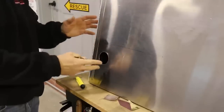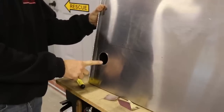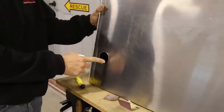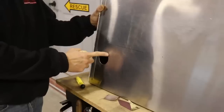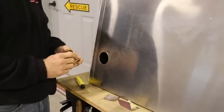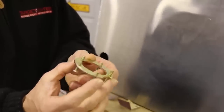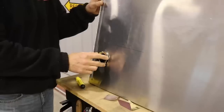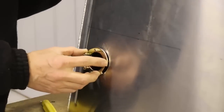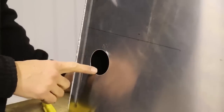All right guys, I have my fuel tank sitting up on its front edge. I have my hole drilled — I used a fly cutter to do this in a handheld drill, and it's very tricky because the top is not completely flat, so the fly cutter will tend to hit in some spots and not others. I did this with a fly cutter, a Dremel, and a whole bunch of other tools. Once you have your hole cut out, the idea is to make the hole as small as possible. The way I test it is I take the ring from the fuel sender, put the screws in so they're sticking out, and just put it in. Right now mine doesn't fit, so I need to keep opening up this hole a little bit — which is good because I'd much rather drill a hole that's too small than too big.